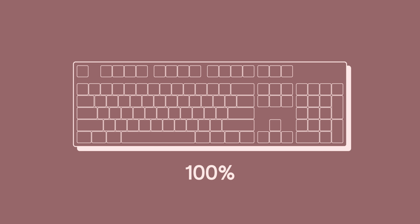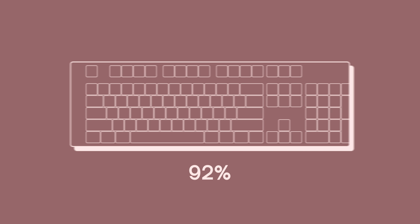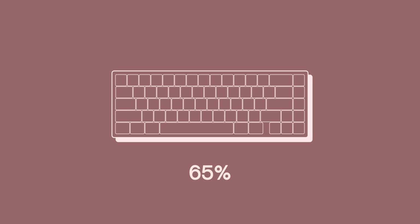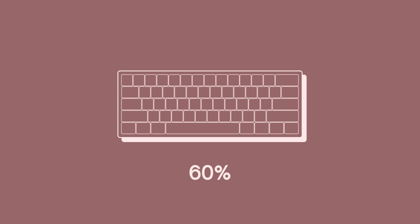When trying to purchase a custom mechanical keyboard, I generally recommend most people to start out with the case, as it determines the form factor for your keyboard and therefore some of the other components that you may need to purchase. Form factor refers to the physical size of the keyboard, and you'll hear it referenced in terms of a percentage relative to a full-sized keyboard, otherwise known as a 100% keyboard. Common form factors include TKL or ten keyless or 80%, 75%, 65%, and 60%, but you could even go smaller with a 40% or 27% if you're a masochist.